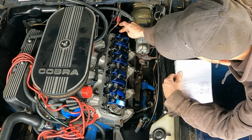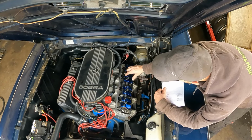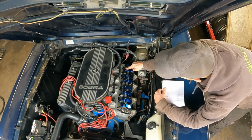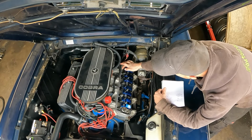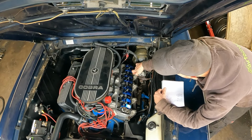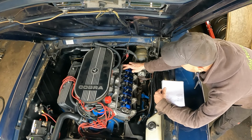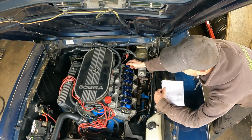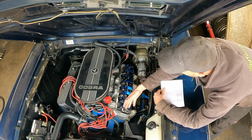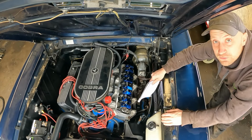And we've got a problem here. All these ones are nice and tight, nothing's come loose, we're still all done up nice and tight, but we've got some movement here which shouldn't be there. So we can see it's not broken a push rod, all the valve looks intact here. So our suspicion is the hydraulic follower has collapsed down at the bottom. But again, to get down to the follower, we have to take all this center off, all this valve gear out. So that's what I'm going to do today and see if we can find the source of this problem.